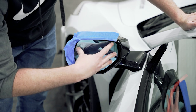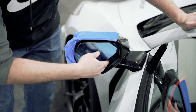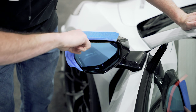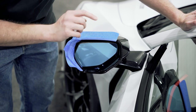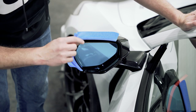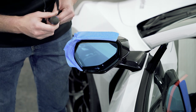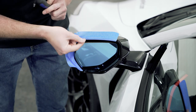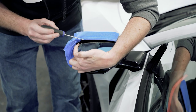Now that we've got our surface taped up and protected, we're going to take this mirror, rotate it all the way towards the inside, then push it all the way down. This will expose a couple of the clips — it's a little hard to see on camera, but when I get the mirror out I'll point out the clips. There are some little clips in here and we need to take a small flat head screwdriver to pry the clips up and away while holding a little tension outward.